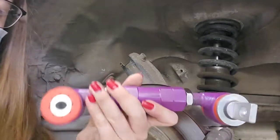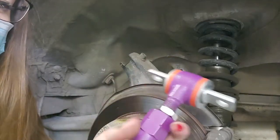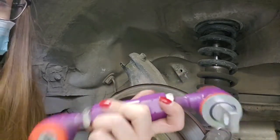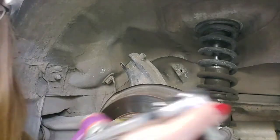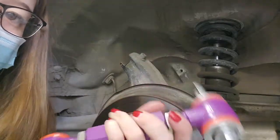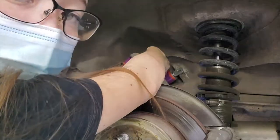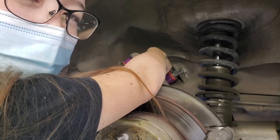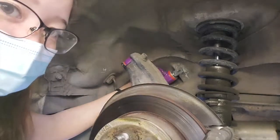We made it match the old one in length, because otherwise it would make the camber even worse. Yes, I know we're going to go get aligned, but you make it match the length so it doesn't make the camber too bad. We didn't tighten these just yet - we're going to put it on first and then go from there. Also, I got a ratchet so I can get this on, and these have to be torqued - the bolts have to be torqued. I have this thing where every time I put a bolt on I think I cross-thread it, because it gets stuck, and it's usually because of all the gunk in the hole itself that the bolt's going into.